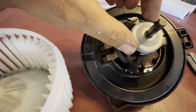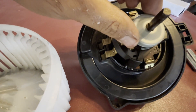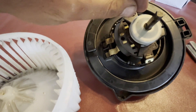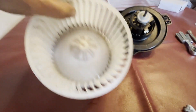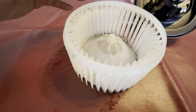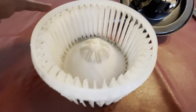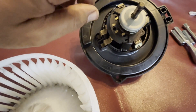The dust cap is back on. When pressing it back in, make sure it's centered — if it's not centered, the shaft is going to rub against the dust cap and you might think it's a bad bearing, but it could just be the noise from the dust cap. Once you clean the propeller, make sure there is no lubrication on it, otherwise it's going to catch dust like a magnet and clog up immediately. Make sure everything is dry and clean.